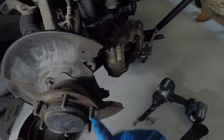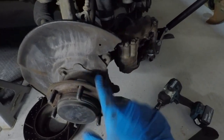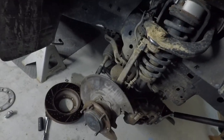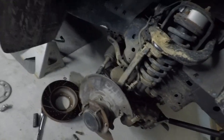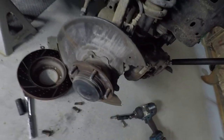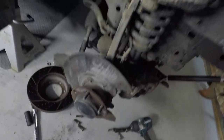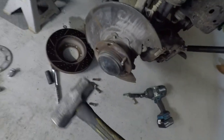What I was doing on the other ones was threading a lug nut on there and hitting it — it would flatten the end of the lug nut a little bit, but we're not going to reuse those if we go back to stock. These are real easy — you just smack it like so and the studs knock right out. That's using a four-pound sledge, just a hand sledge.